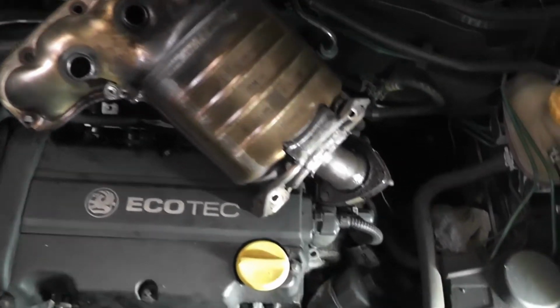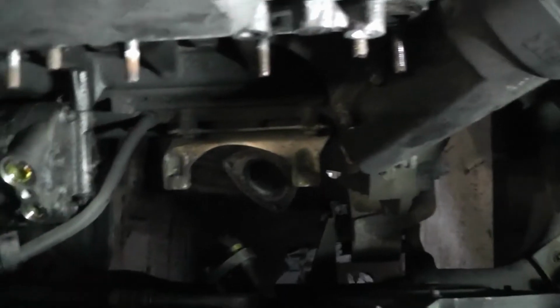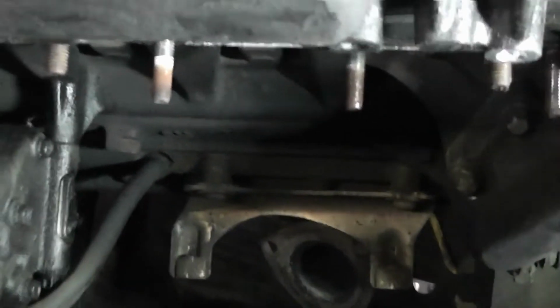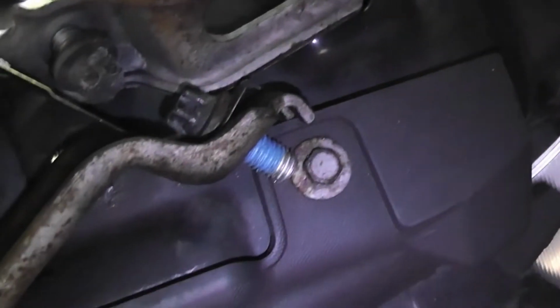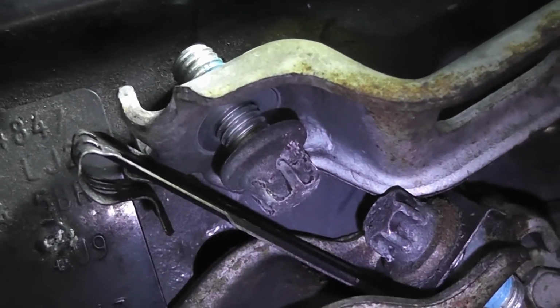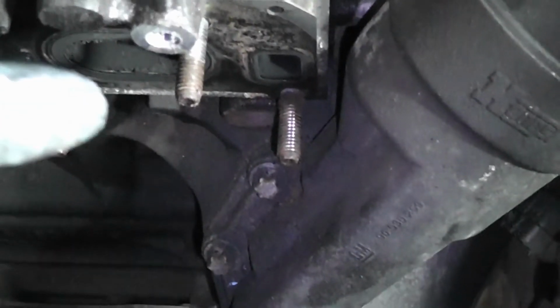I skipped a part to actually take it off. As you can see, there's that bracket at the bottom, there's 2 bolts on it holding it. That's an E11 socket. The top ones, as I said, they're all 10mm. There's been 2 brackets as well, sporting E12. Again, you can undo them with a ring spanner, but if you've got E-Torx, that's better. There was one by there sitting in this hole, and there was one bracket this side.